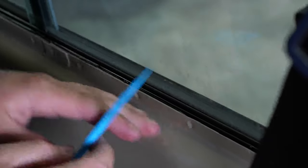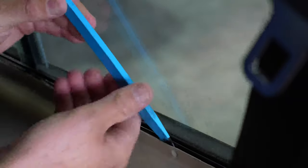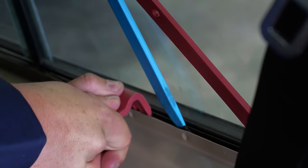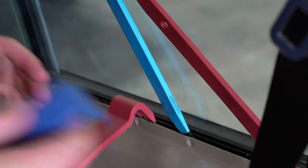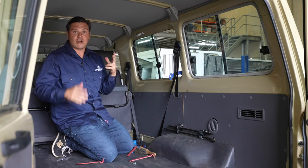We've removed all four clips and we're trying to separate the window from the sill. Depending on the age of your car, there's some really tacky mastic in between the window and the sill keeping it sealed. I just use the same removal tool — be nice and gentle and patient — and work around the whole length of the window to separate it. Sometimes two, three, or four tools can be really handy. Like doing a tyre on a bike, once it starts to go you can put pressure on the whole window, but it's best to take your time and work around.